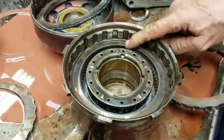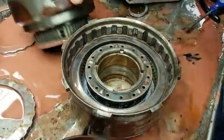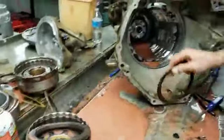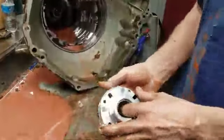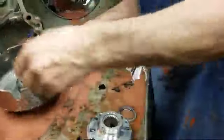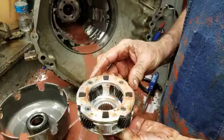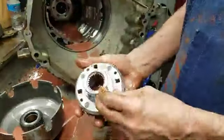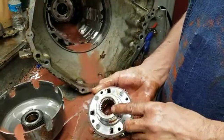If you can get that plate right there, you can get them at any transmission shop — they'll sell it to you for 10 or 15 bucks or less. That's making a much better transmission. Now going back to the diesel comparison — all diesels have steel planets. This is an aluminum planet right here. This actually slides into the shaft that goes to your drive shaft. All diesels are steel; gas engines get aluminum.